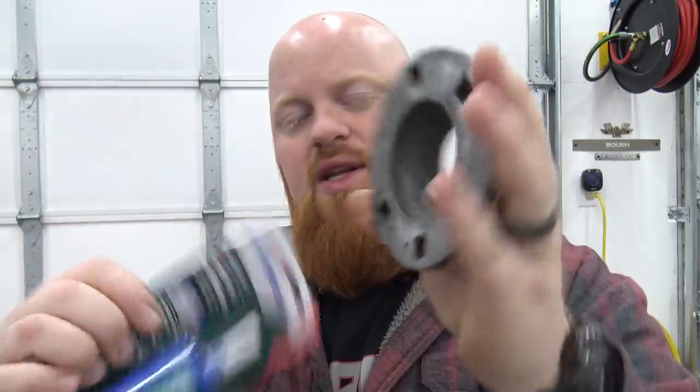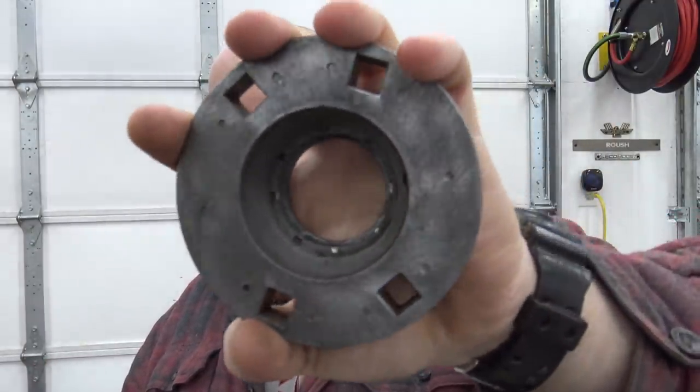So I'm going to use this sleeve retainer to hold my seals in instead of bending those tabs. That's going to allow it in the future, if you blow a seal and have to pull out an axle, you don't have to do any more grinding, because what that's eventually going to do is leave you no room to bend tabs down. This thing could be around forever, who knows. This is the same thing as the Loctite 638, I think it is. I had to order this. No parts store kept this in stock.